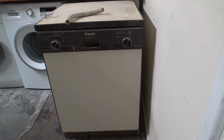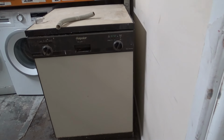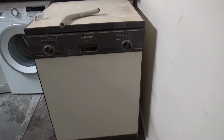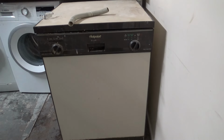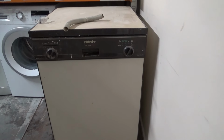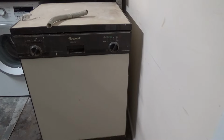And just as I literally went to stop the camera, it's tripped the electric. But it's only tripped a small amount. But that being said, I don't think maybe it's anything to do with the heater. Because we're on normal wash, so it's supposed to do a pre-rinse first, followed by a main wash. So I don't think it heats on pre-wash, but I'll just double check.